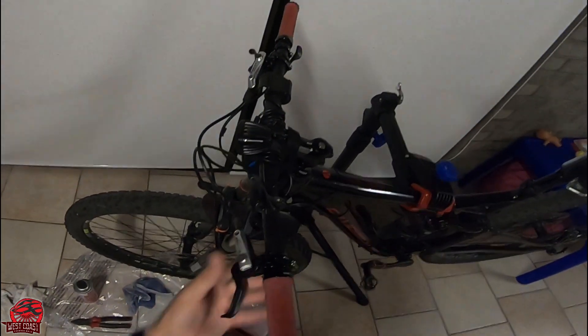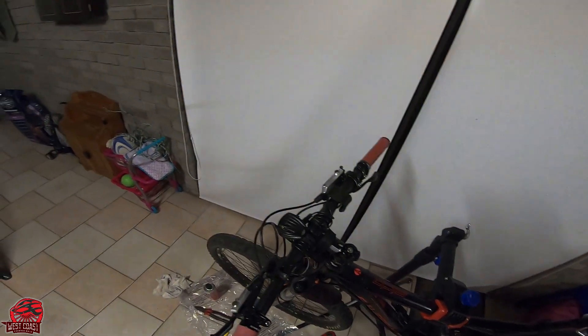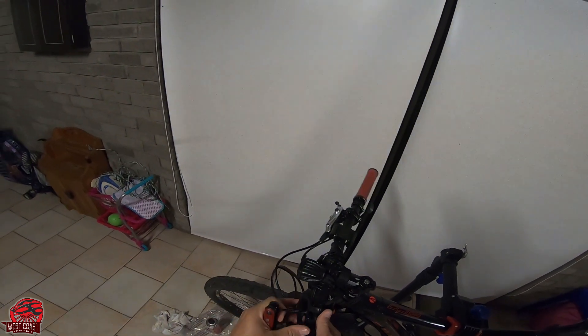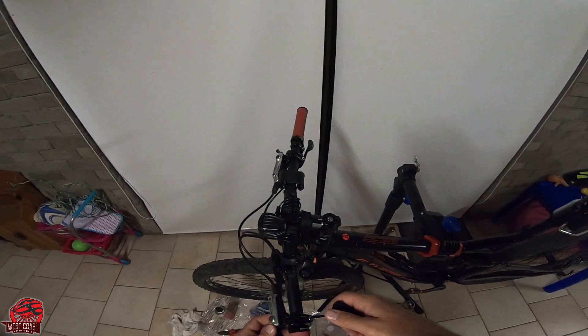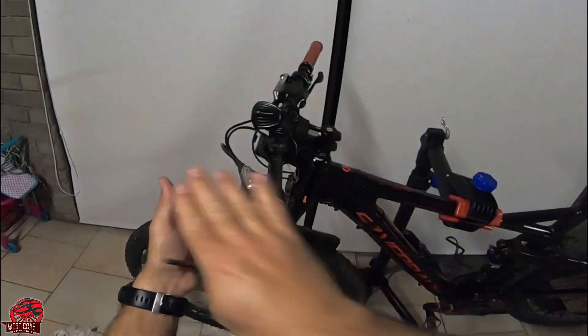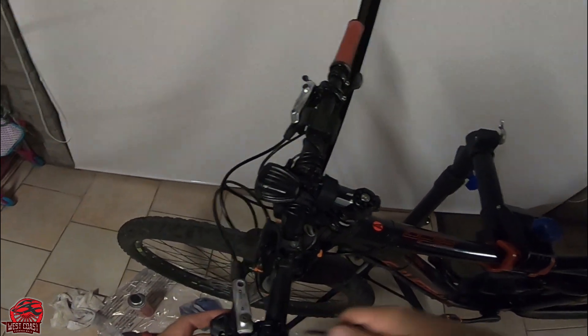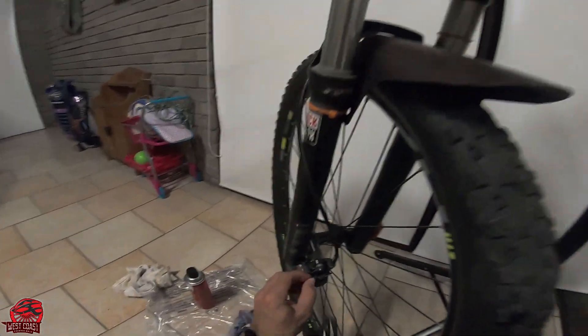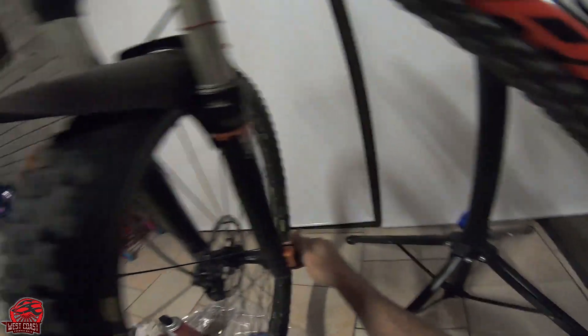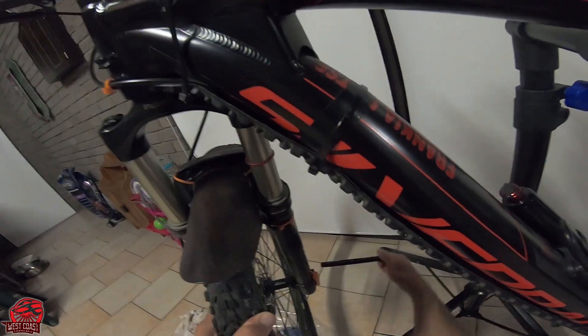We need to position this brake lever so it's slightly more level, but to do that we need to get this little release for the shock out of the way. Release here by the screw so it won't move. That looks to be more level so I'm just going to leave it there for now. Then I remove the split pin so I can remove the brake pads, and loosen the axle bolt so I can remove the front wheel — it's just going to make things a little easier with it out of the way.